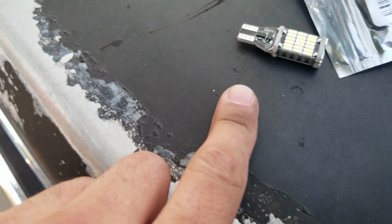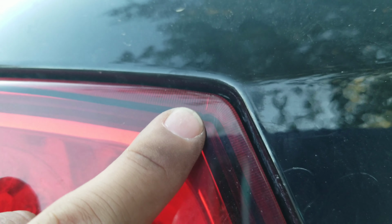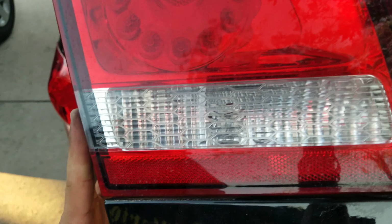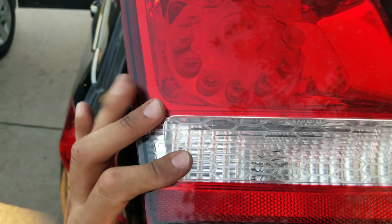All right, I got some bad news. The reverse lights I bought for the Journey didn't fit. Like I said, I removed these two bolts in case you do want to do it. I'll try to research what lights it does require, and I'll put it in the description. But you guys got to be careful again. I actually cracked the lens right here and some of the paint. So just be careful with these. I think I'm just gonna leave it as it is. I'll just wait till the bulb pops or whatever, and then I'll change it to LED. But everything's brittle because of the heat here in South Texas.